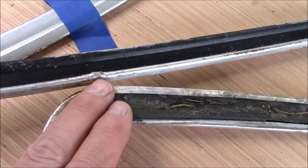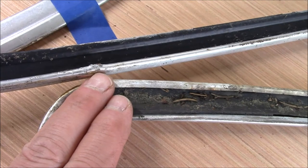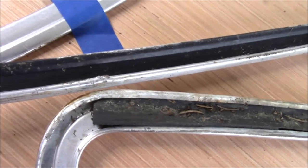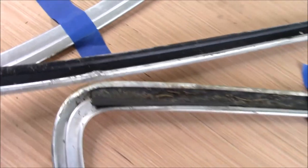Here's something I wanted to point out — as I talked to you guys earlier about using screwdrivers to remove this molding. This is what somebody did here. They rolled that molding up. There are two reasons you don't do it; this is one of them. The second is you can scratch the glass.